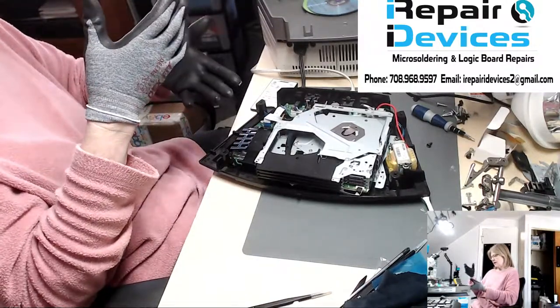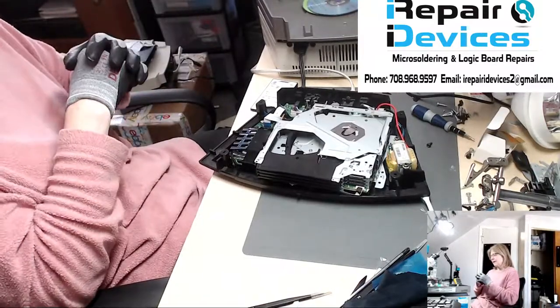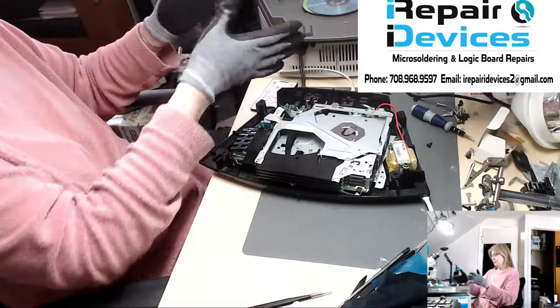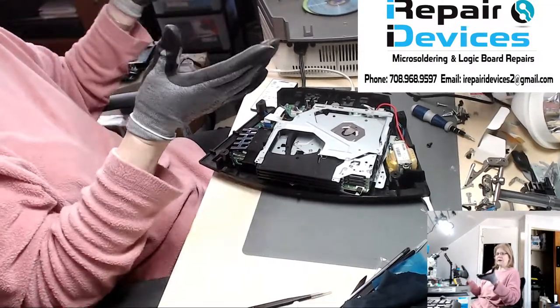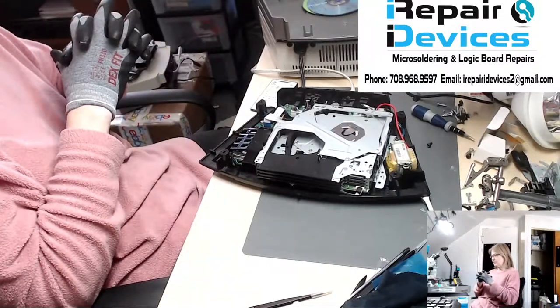He was actually under another gear, and so I had spares of those, removed it. Then I went and tested it out. The clicking and grinding had been removed, but when I put in the CD to test it out, it would just spin really fast and eject it out. Well, that was due to the optical sensor being bad. It failed. And those things do burn out.